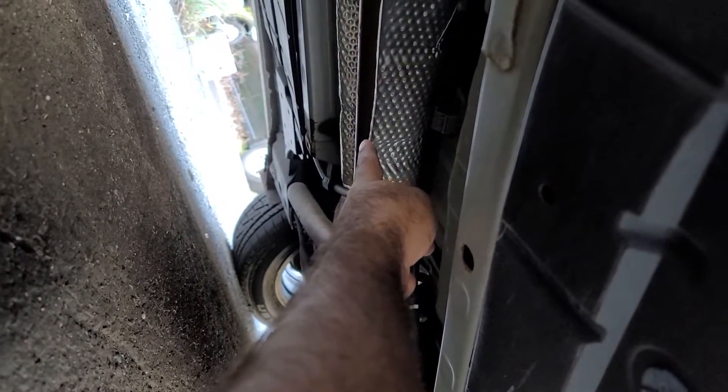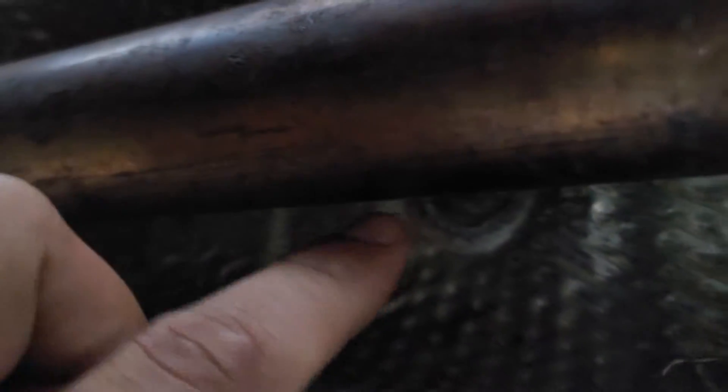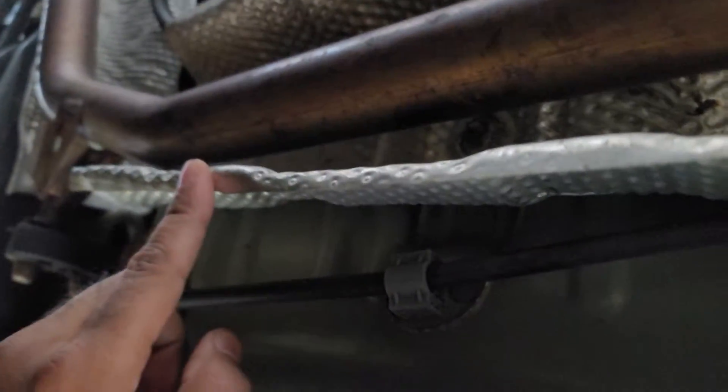So I'm going to find out how to fix it. What I figured out is there's a bolt here, right there behind the exhaust pipe, that's broken. So it can't hold it up and I can't find anything else that could hold up this exhaust heat shield. This is why it's moving.